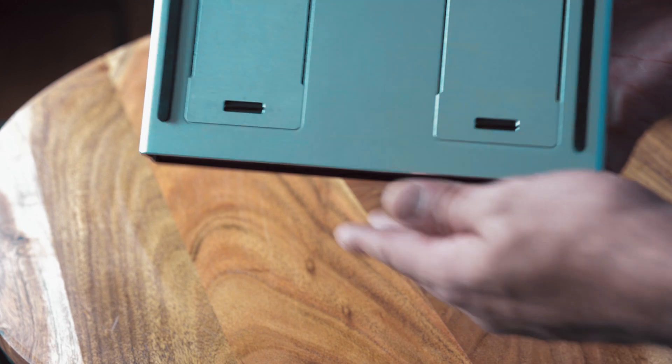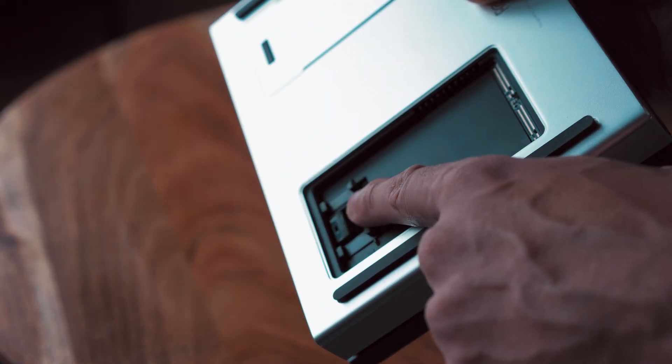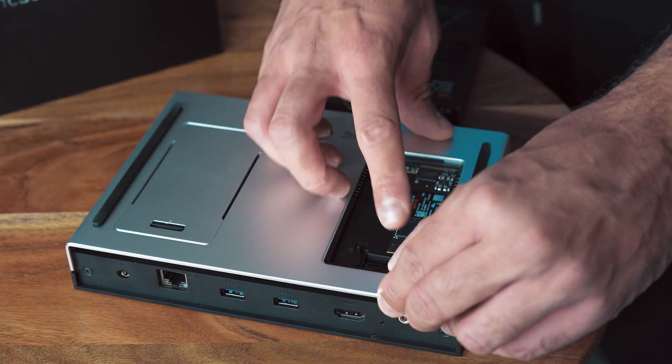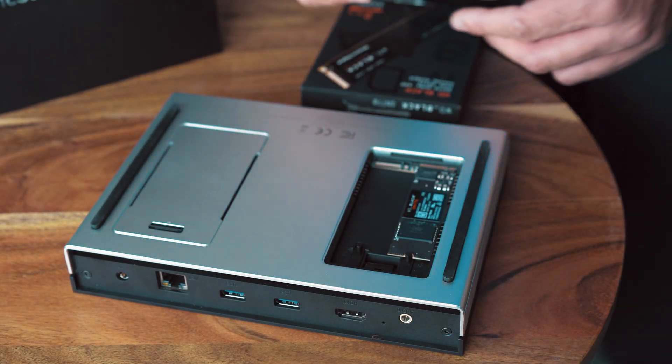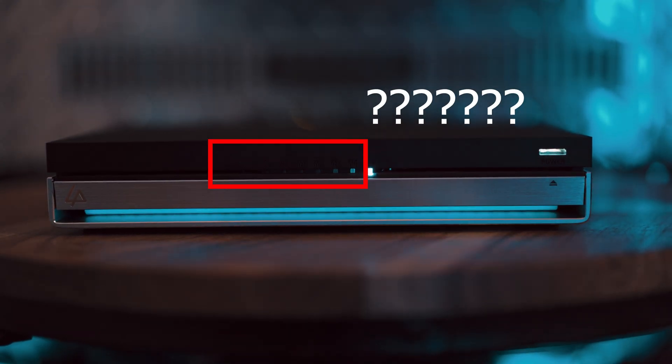Now that we've looked at the features and the cost, let's get the show on the road. Installing the drives is a breeze — just flip the LinkStation over, open the compartments, and notice that we have the USB stick there which has the Unraid OS. If we want to install another OS, we have to remove it or at least not boot from it. I made a mistake here: I was paying too much attention to the camera and didn't insert the NVMe all the way, and then I was wondering why the LinkStation wasn't recognizing my drives. Just make sure it goes all the way in. I could have reshot the video, but I'd rather you see the mistake in case you do it as well.